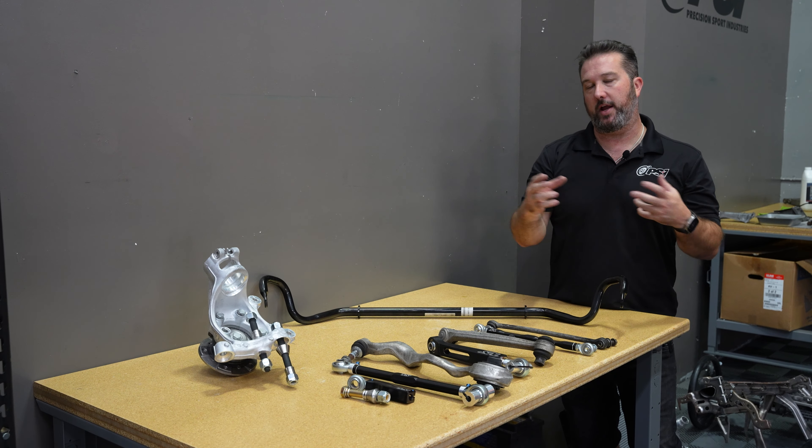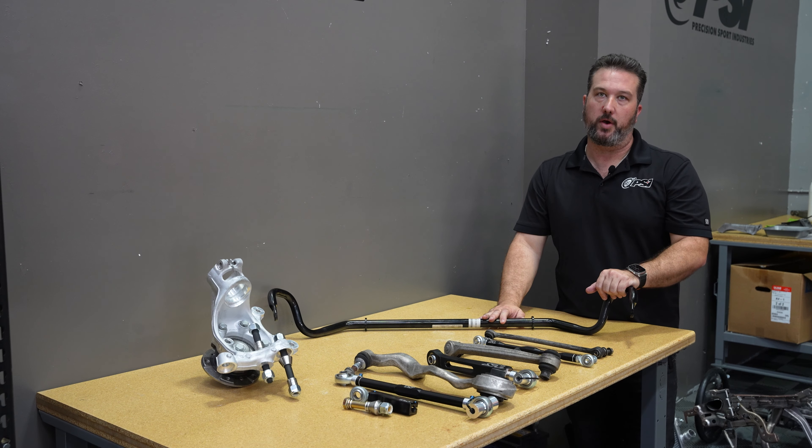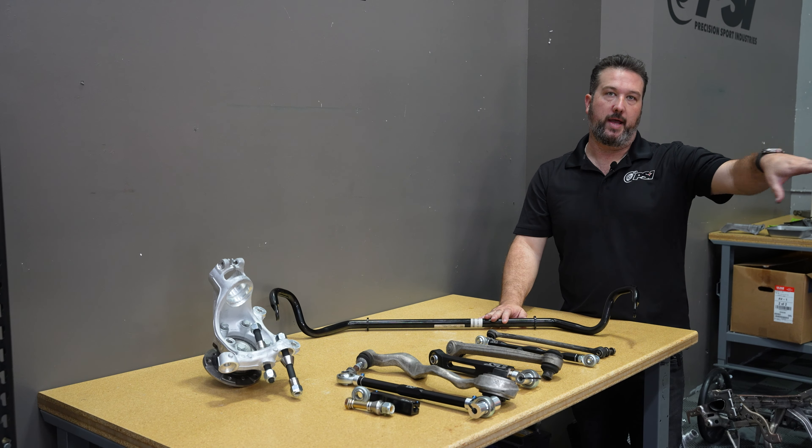There's a tension arm with bearings and heim joints instead of rubber, so there's no deflection point when braking and under high performance driving. Here's the lower control arm — there's a heim joint on the SPL where the factory has a ball joint, and a bearing on the other side where the factory has a rubber bushing. No deflection, lots of adjustment via a threaded rod. The sway bar link also has multitudes of adjustment and is a solid mount instead of rubber. The big piece on the table is the factory front sway bar from the E92/E90 M3, which we're relocating to the E91. That's straightforward since we already have the subframe in place and all the M-specific suspension arms.